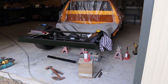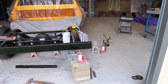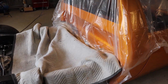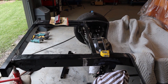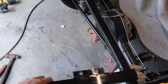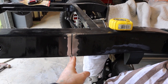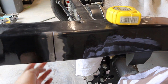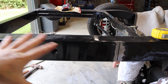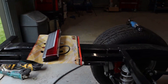In the last episode we talked about starting this tray for the tonner and encountered an issue — the right-hand side chassis was kicking up, this rear cross member was bent up and was just on the piss. I appreciate all the comments and suggestions. Taking them into consideration, I decided the easiest and best option was to do a relief cut on this side. I pulled the drop tank out and cut the bar for its mount, thinking that would relieve some pressure. I put a relief cut in the chassis on three sides using a 2.5mm cutting disc, leaving the top uncut, but it still had heaps of pressure and I couldn't bend it down.